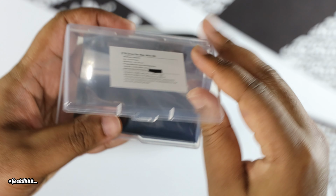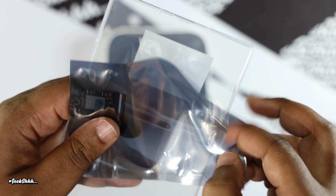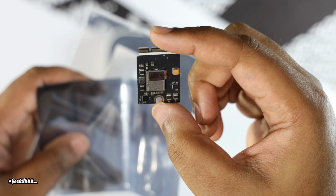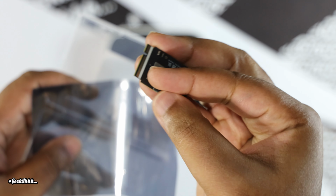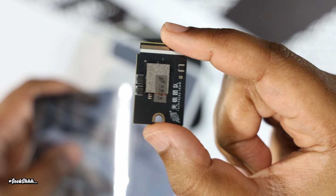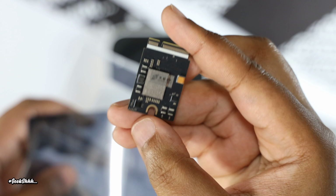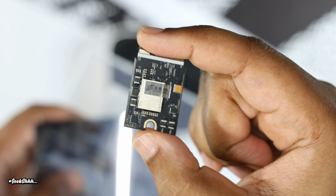All right, y'all. So there you have it. Now, the disk speed test that we did, whether it was the OEM or the new SSD, they both had the same temperature when they was conducting the test, whether it was the 1 gig test or the 5 gig test. But you did increase the speed on the new SSD, so that's a good thing. But what's concerning is when I did the transfer test of the 180 gig folder. Now, it took 13 minutes on the OEM, but it only hit 49 degrees. And I think a large part of why it took so long on that is because it's 180 gigs going into a 256 gig SSD. That's a significant amount of space.